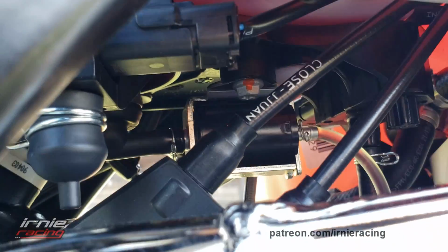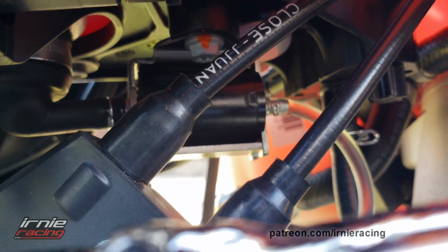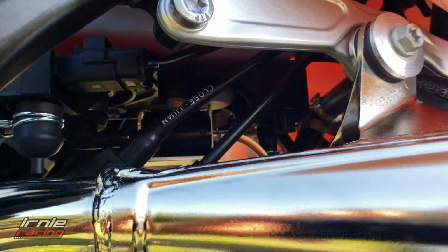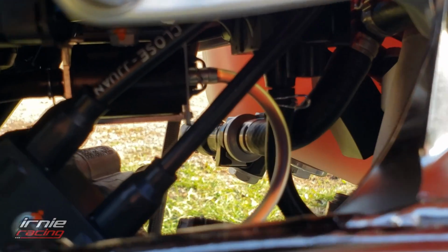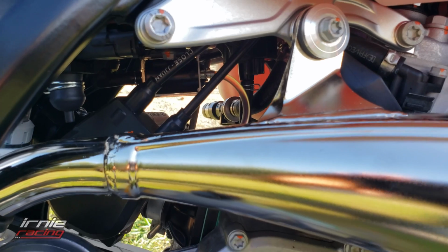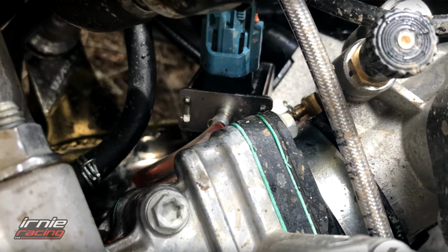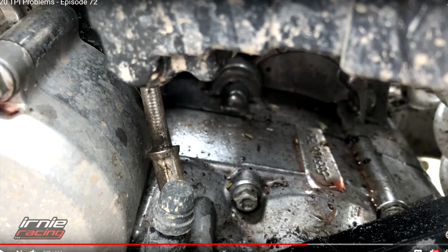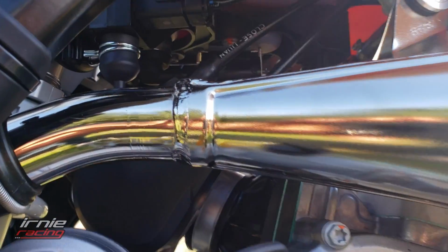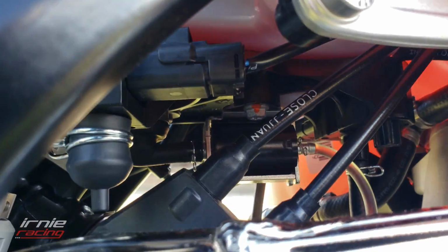Now I have seen a case where a racer in the Pacific Northwest posted that that bolt had come out. That bolt, which holds your oil injection pump, and you can see the oil line going below, had come out, and it had fallen down, and then the oil was just leaking on the top of the engine, not going into the engine. And luckily he caught it in time, and his engine, the piston was all checked, and the sleeve, the cylinder was fine. But so I got it marked, as you can see again right there, ready to go.